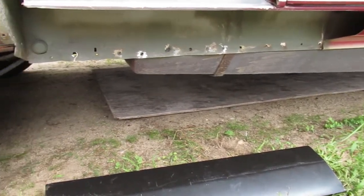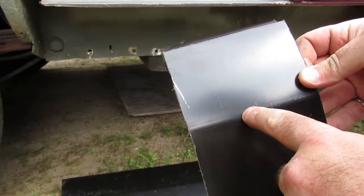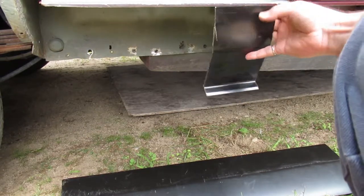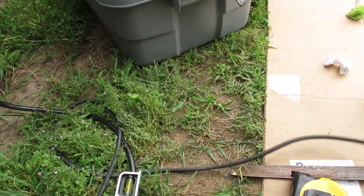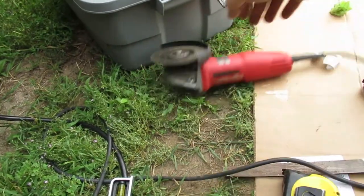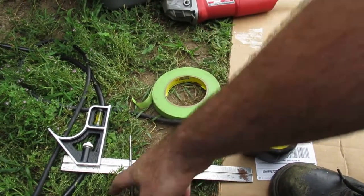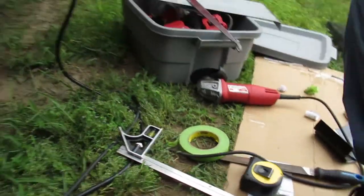We're making a bit of progress getting the patch panel to fit. I found that where the body line is, it's best suited going over — it lines up the body line correctly. Going from underneath puts it off a little bit. For tools, I've got a Milwaukee grinder — the 6130-33 — I don't recommend it, it's underpowered, heats up too much. But I've got a Diablo thin cutting blade on it and that's very good. Also using painter's tape and a scribe for marking lines.